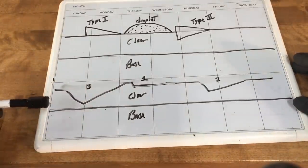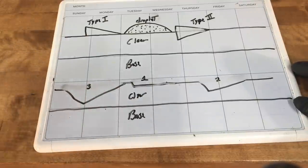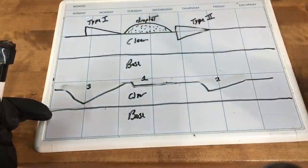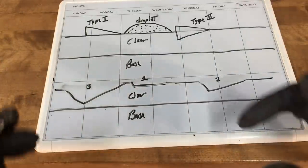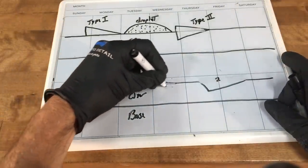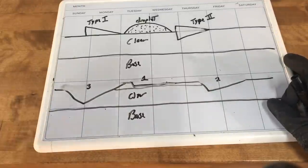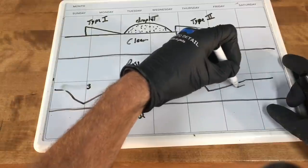On this next diagram showing base coat and clear coat, I often come across three levels of damage from the etching alone, after you've chemically removed the scaling from the surface. The first phase of damage is very shallow and can be removed simply with a one-step or enhancement, which will lightly shave the top of the clear coat. Those will normally be totally gone.